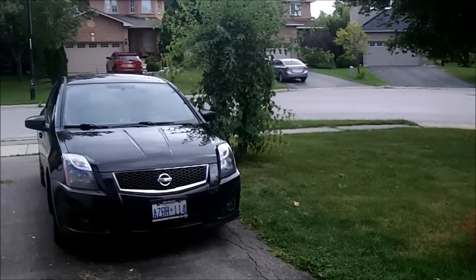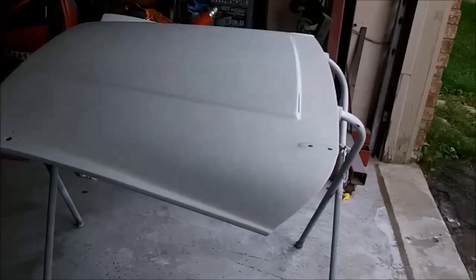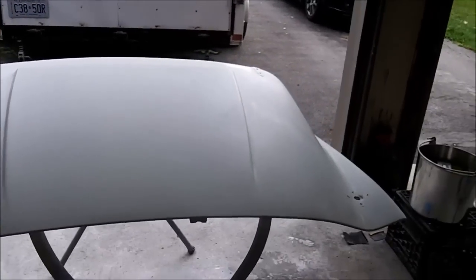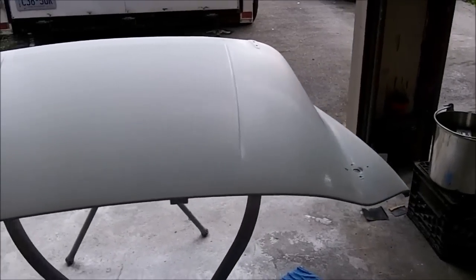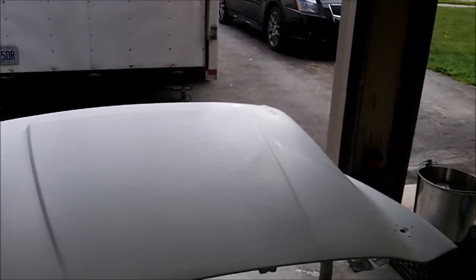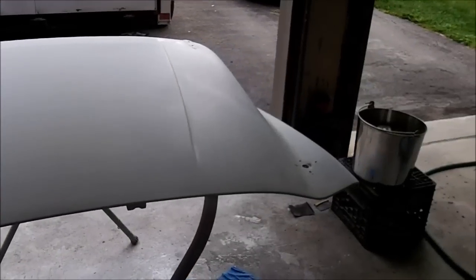We need it to get a little bit warmer anyway. What we're going to do is flip the hood back over the bonnet and work on the underside today, hopefully getting it into base coat and clear coat. As mentioned yesterday, we've got pretty much the top side and the bottom side sanded down where it needs to be. There are a few shiny spots that need to be scuff-sanded, but other than that it's pretty much ready to go.